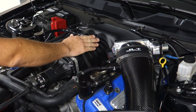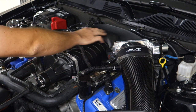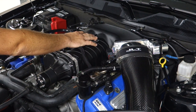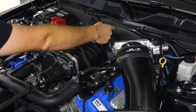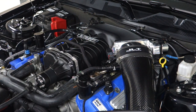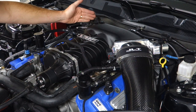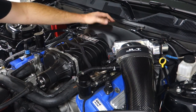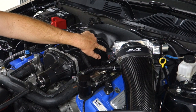And this is the part that's totally different for Gen2. We made the Supercharger elbow and the rotor housing all one piece. This allows us to optimize airflow through this entire turn. We also made the internal volume as large as possible for maximum flow. We pushed out the back as far as we could, raised the roof, and even got some great flow improvements under here where you can't see.